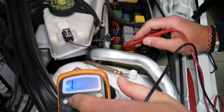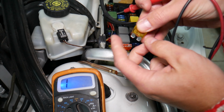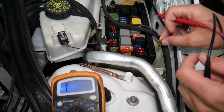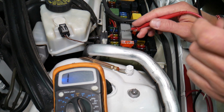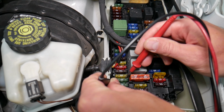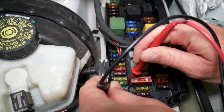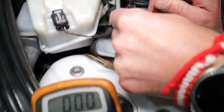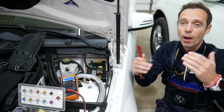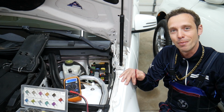Now, some fuses are super hard to see if they're burnt or not. Some of them will be really easily accessible and you can clearly see them, but there will be fuses that are not see-through, fuses that may look like they're not burned, but they're actually burned. Often you can even test these fuses without even removing them. But it's very important to know how to test different fuses and relays, and if you want to see how to do that, we're going to put a link to a video in the description below on how to test a fuse and how to test a relay. Always check that. I want to emphasize that enough because it could be a really simple fix.